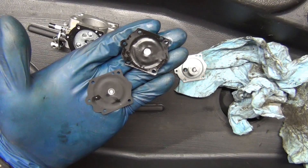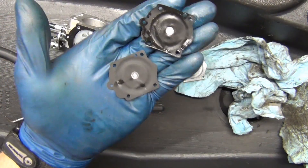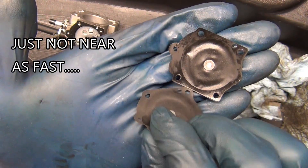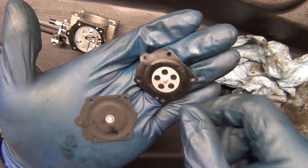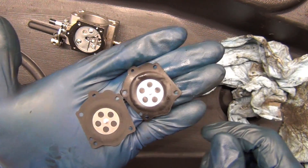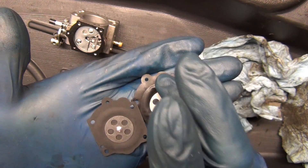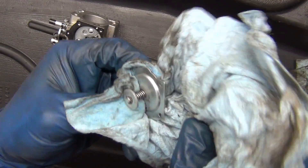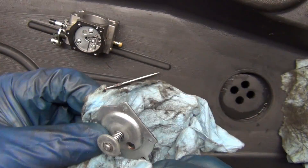These wear out even if you use Avgas or Clear 88 which contains no ethanol. I've got these both wiped off and you can see there's just a marked difference between the two of them — this one's just so worn out, so defeated. I was still flying on this, but you can see it's like loose extra skin. So if you push on this part here, it's like turning off the fuel pump and the engine just dies.